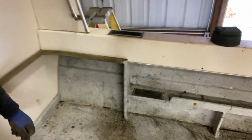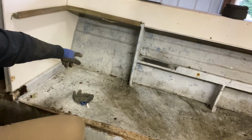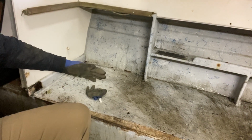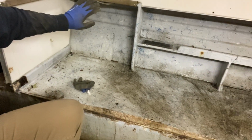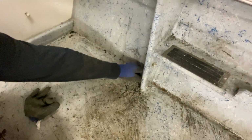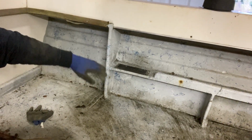And either way, it's going to have either a new floor all the way against the side of the boat, or I'm going to inlay it and fill in some, or I'm going to just grind it down flat and then lay some 1708 up on the side to make it so water doesn't sit right here, because that's just a spot for it to run. It can't run down through, so it just sits against there in a little corner, and I don't want that. So I'm going to make it completely flat, or even make a little bit of a raise so it wants to come out.